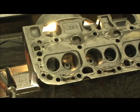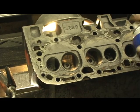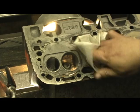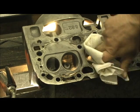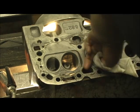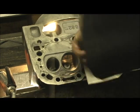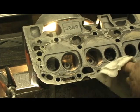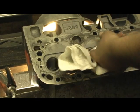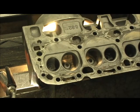Before you ever take that sonic checker wand to the head, I cannot emphasize enough how you've got to go in here and just shoot a little carb cleaner in and make sure that you get them surfaces perfectly clean. I had to buy one of them wands the first six months I had it — they were $300 for one of them 15 years ago. Any kind of little metal debris, even stuff that you wouldn't feel, kind of like putting the head on the flow bench — the ports have to be really clean where there's no metal it can pick up.